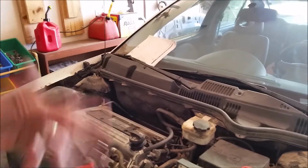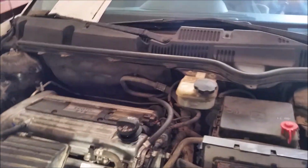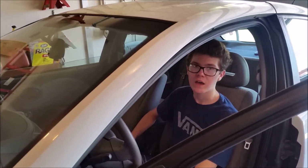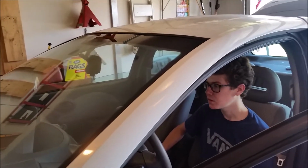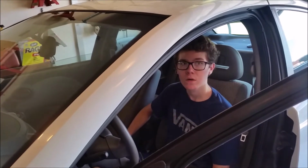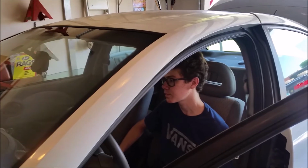Just leave it on low RPM, let the oil circulate. Because we had that oil starvation problem when we got it, I think. When you saw those journals on the camshaft, you think that was low oil pressure or no oil pressure? Yeah, I had to do low oil pressure. Oil starvation. I mean, like symptoms of oil starvation, like popping filters. Really? Okay. So I don't hear any rat-a-tatting, so I'm reasonably confident the bottom end is okay. You agree? Yeah. All right.